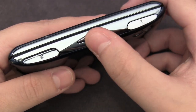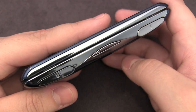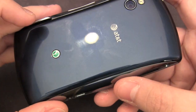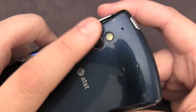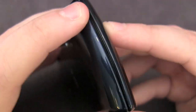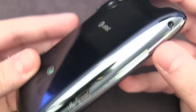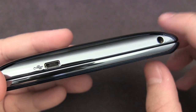On the side you can see the volume rocker. It's placed a bit awkwardly alongside the shoulder left and right buttons, but it's still easy to press and gives a nice clicky responsiveness. Towards the back you can see AT&T and Sony Ericsson branding — this is the cobalt blue model exclusive to AT&T in the USA. The back is glossy so it picks up fingerprints and scratches. There's a 5-megapixel camera with single LED flash and built-in autofocus, a secondary microphone, a flush power button with notification LED, a 3.5mm headphone jack, and micro USB charger.